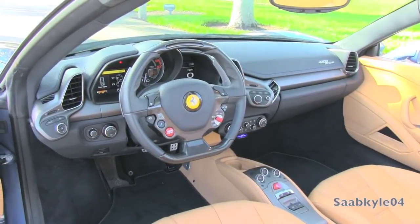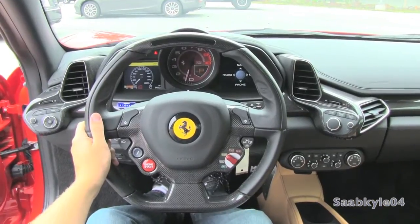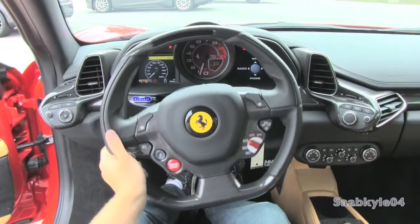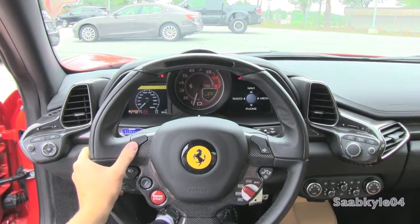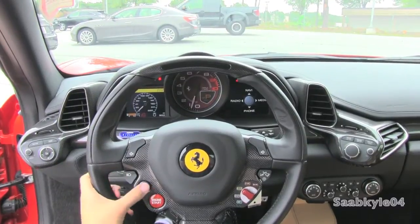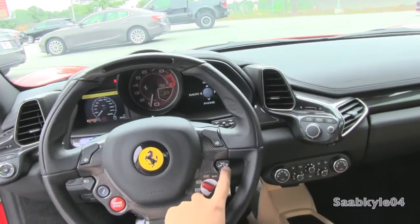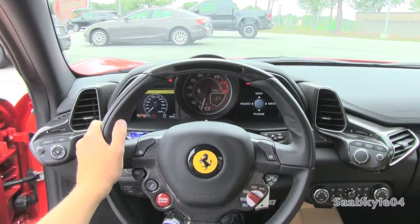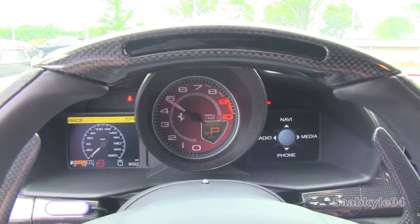Direction is provided through rack and pinion steering with speed proportional hydraulic power assistance. The 3-spoke leather and carbon fiber steering wheel incorporates all of your primary driving controls, part of Ferrari's human-machine interface approach. It places everything within the driver's immediate reach, from the indicators, wipers, lights, and bumpy road setting to the Manettino drive mode selector in the bottom right. The horn buttons are integrated into the upper grip bolsters. In the top of the wheel is an LED light strip that illuminates the proper shifting interval.